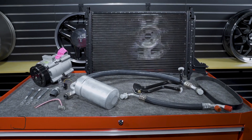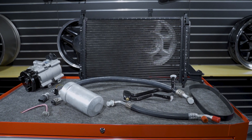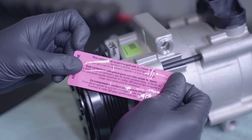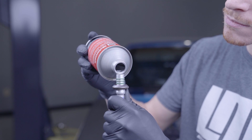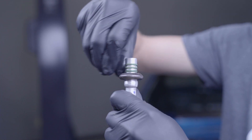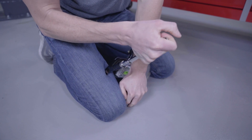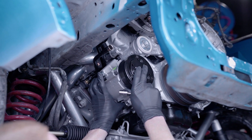It is still in the early stages of completion, but most of you installing the SVE-AC kits will probably be at a similar point in your build as well. Going into this install I would recommend pretty good mechanical knowledge and experience with HVAC components. Before you get started, go ahead and have all of your supplies ready to go prior to installation. This includes PAG 46 oil. Throughout the installation you will hear me repeat myself several times when it comes to cleanliness while you work, O-ring lubrication, and clocking of the aluminum lines.